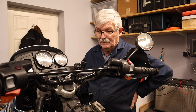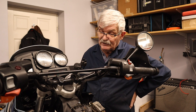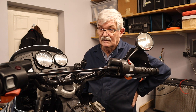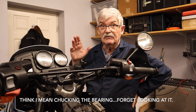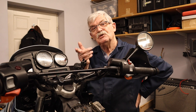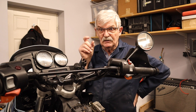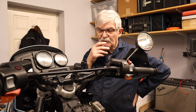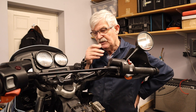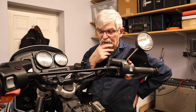It's quite a big job in some ways. The bearing has just arrived from Motorworks - it's only 20 pounds. The wheel has to come off, the forks out, handlebars off again, and then we have the difficulty of taking the top yoke out, heating it, getting the bearing out. I went on YouTube and there's nobody that's done it on a 1150 GS. There's somebody with a very short four-minute video doing it on an 1100 RT from the 1990s - the principles are exactly the same but very little is shown.